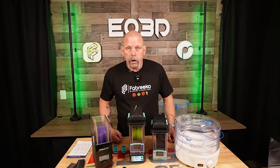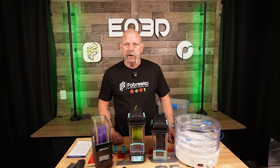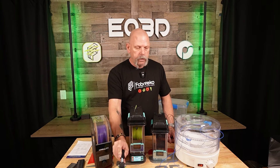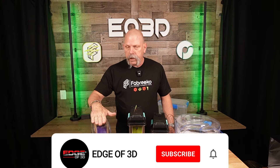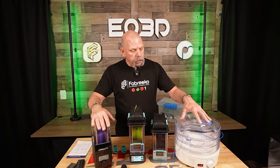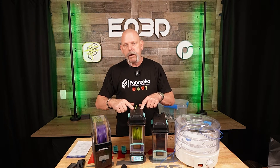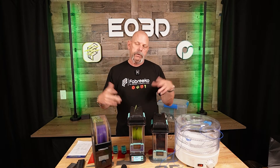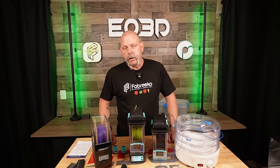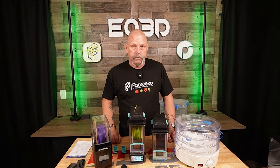So, to get on to the questions — the number one question is: how noisy is it? Well, it's running now, you can't hear it. I went ahead and checked it with a dB meter. The one that came in the lowest was the Creality at 53.3 decibels. The loudest was the old school dehydrator, that came in at 70.8. The Polymaker dryer came in at 58.2. Just for reference, ambient noise in this room is 31.7. So it's not loud — you can hear it, it's fan noise.